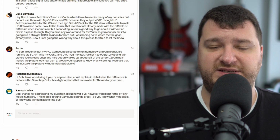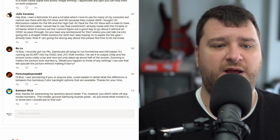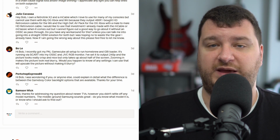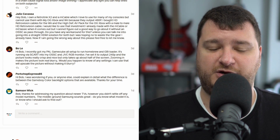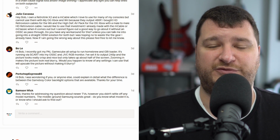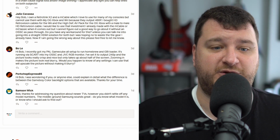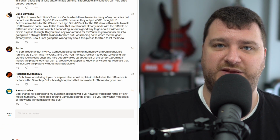So through your OSSC, I think Firebrand X have some specific settings for that. I could be wrong. Through the FrameMeister, he definitely did. So you're able to zoom farther than you would on, just using it through the GameCube or the original Super Game Boy on a Super Nintendo. On your JVC RGB monitor, not really. You could get dedicated hardware for that, but it's essentially just scaling and stuff. And I don't know how well it would work, and I don't know how well any hardware would ever work in a scenario like that for an RGB monitor, unless it was specifically designed to be used with Game Boy.